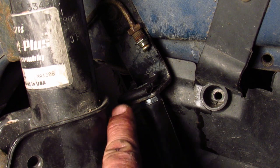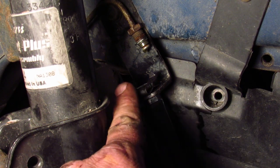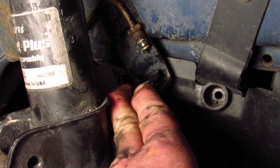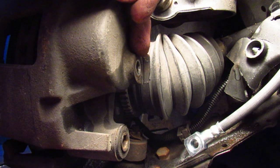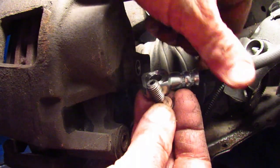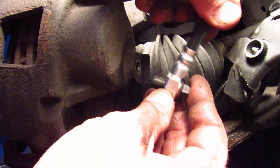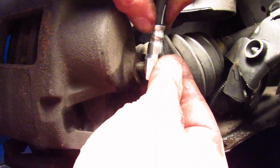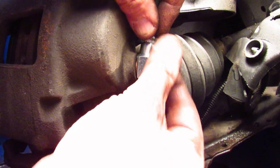I'm working in really tight quarters, so I'm not going to show you the whole process of sliding the hose into the bracket, but I will show you the process of pushing the clamp back in place. I've made sure that the mounting surface on the caliper is really clean and the bolt's clean, so I put one crush washer on the bolt, and I'm going to put the other one on the other side, and then carefully thread the bolt in to make sure that it doesn't strip.